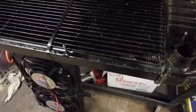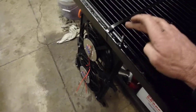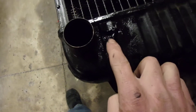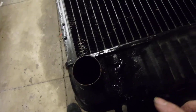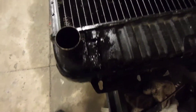But it really is the only way to go if you want to put electric fans or make your big block Camaro cool better. I just decided to weld — I welded studs onto the support with my MIG welder, and then on the tanks I soldered. I was also able to get the MIG welder and weld to the bottom clip for the old fan shroud, and sweated that one onto the brass. Make sure you wash it off with water and paint it, otherwise they turn green and it's an ugly thing.